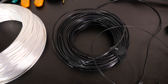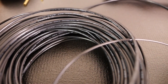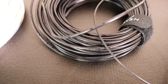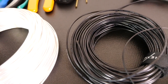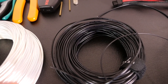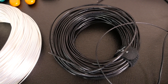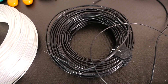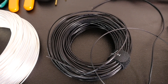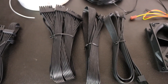Now let's start with choosing your wire. I've used a lot of wire with insulation that's either too soft or too hard. If it's too soft the pins pull off easily, it's not durable, the insulation can melt when heating heat shrink, and it doesn't train well because it springs back. You run into similar problems when the insulation is too hard — the pins often break and the crimps break because they won't stick into the insulation properly. You need three different sizes: 16 gauge, 18 gauge, and 22 gauge. Use 16 gauge for the core components — 24 pin, PCIe, EPS, and ATX.